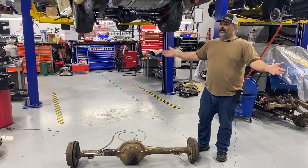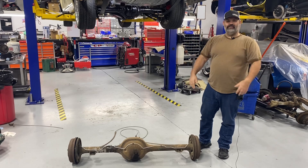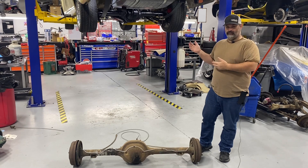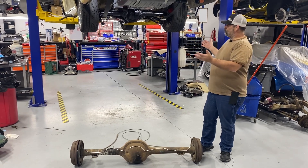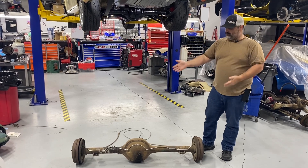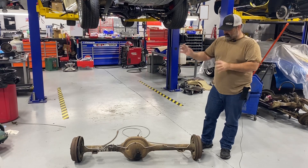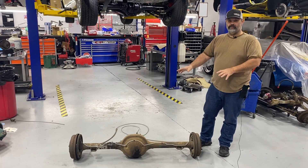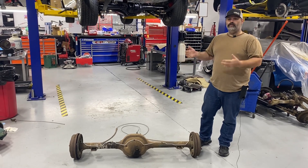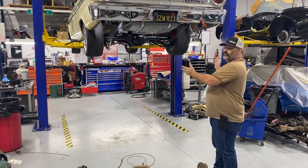Welcome back. I'm making this video mostly because of the Facebook group for the Fairlane people. Everybody pretty much knows how to swap a rear end, but this is an 8.8 swap — removing the factory 8.0 rear end. The factory rear end comes with a 3.0 gear, really great behind a 302 and a C4 if you want a cruiser car, but if you're going for more of a street car, this is where you go.